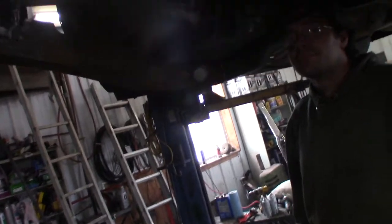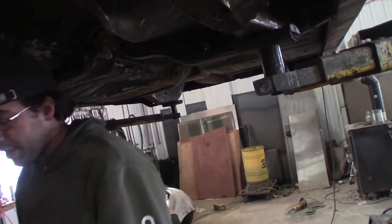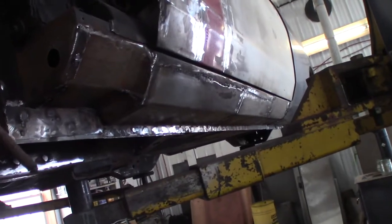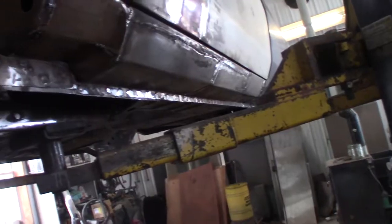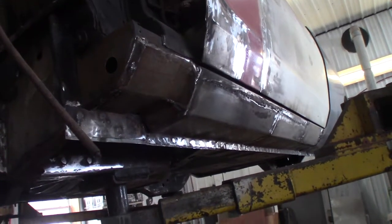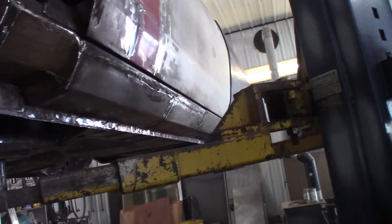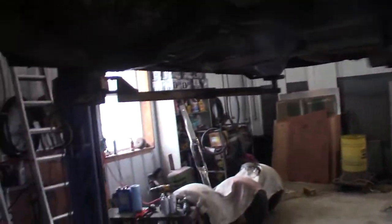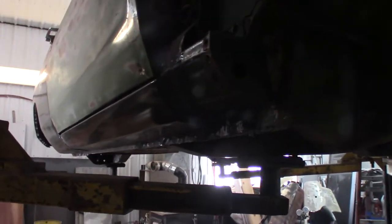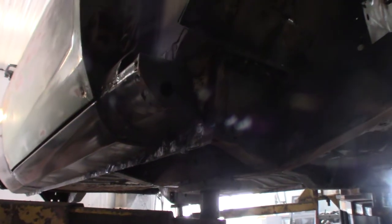The cowl, the roof, and that rail - that's what you started with, because you could throw a cat through the floor in the trunk. Changed all the floor - pretty much all the floor and the rockers and the outer rockers. I made my own inner rockers, which was tedious, but that's really just flat steel. And then that rocker I made was kind of hokey, but it's there. And then I bought an AMD rocker for this, which is a nice piece - one solid piece.